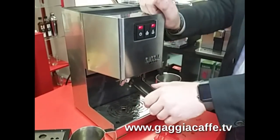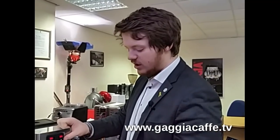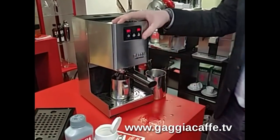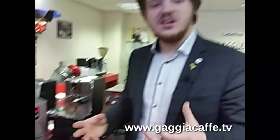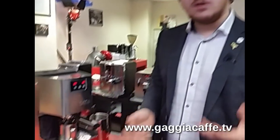You only want to put a slight amount of water through the portafilter — just enough to wet the tablet so it froths up. It'll have a slight reaction to the water, froth up, and actually clean all the coffee oils out of the handle and also help with the cleaning of the shower head and shower disc. Press the button for around two seconds and leave it for about five minutes. The tablet will take its effect and froth up, and when it comes through it should be very foamy and soapy — possibly coffee-coloured — and that's actually cleaning out all the coffee oils in your handle.